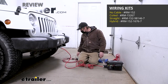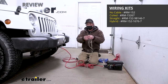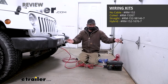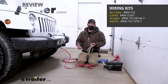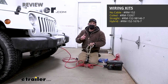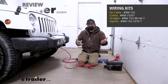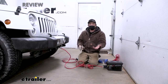There are two more kits available. One is probably the least popular but is there if you need it — a four-way flat connector to a four-way flat. If your motorhome has a four-way flat, plug that in there and it'll transfer those signals. Then there's another kit that comes with what I call the bare bones: you get your wiring, diodes, a couple of connectors, and small things, but no six-way round connector or cable. That kit exists because some higher-end tow bars come with those components included.